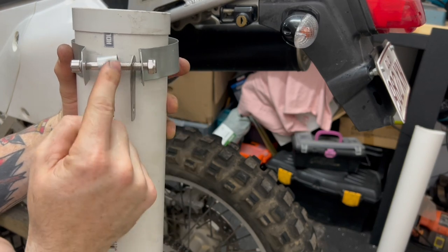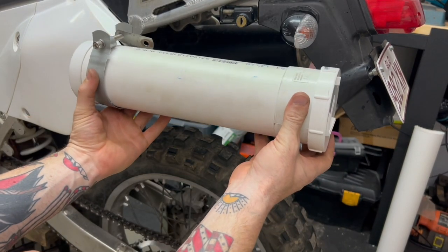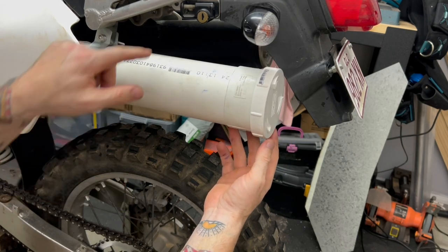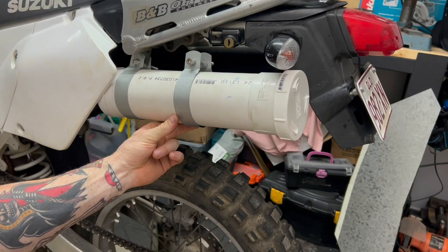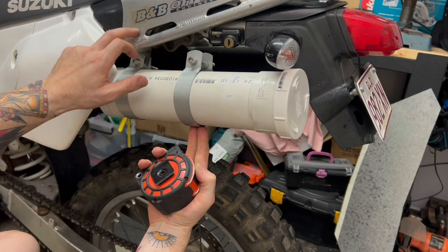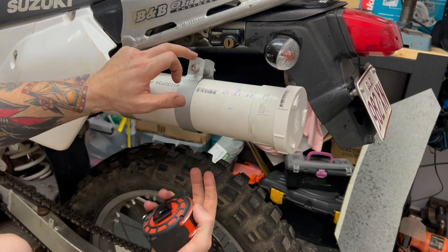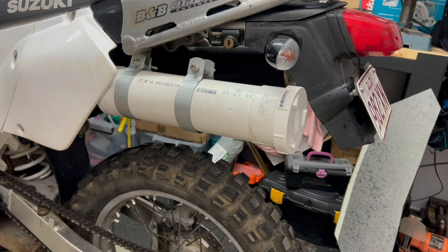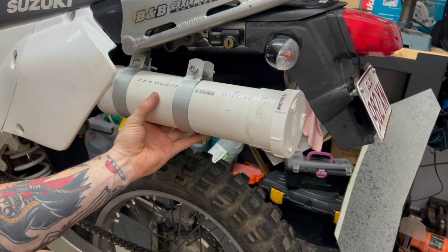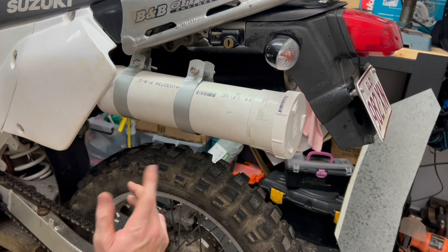We've got our spacer cut now, so that's going to go in between these two pieces here — that is our bracket that's going to attach underneath the rack and hold that end snug and good to go. That's basically the front one done. I've got it in there loosely but I'm going to put the other one up around this general area here. The bracket's fine, but the little piece that joins underneath onto the actual rack itself is very thin sheet metal, so I'm actually going to swap that out. The back bracket I'll make out of a little bit of mild steel — it's just going to be a little bit sturdier, especially while I'm riding with some weight moving around. I want it to be a bit more secure, so we'll get them measured up, cut them out, drill them, and then bang them on.